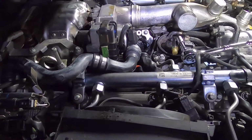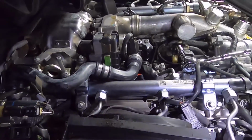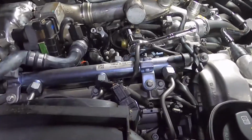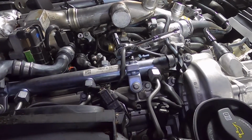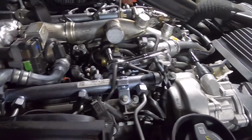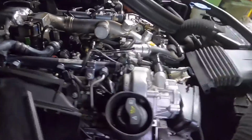Okay, I think we'll put the butterfly on, or the bat wing next. Get that sensor seal in, reseat the seal to the turbo, and then apart from the cover I think we're done. Just put the cover and the grommet and a few air pipes. Good news, there's no spare parts on the floor.